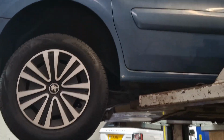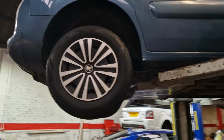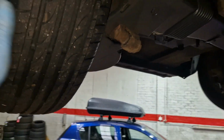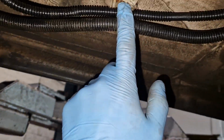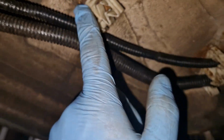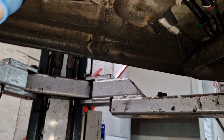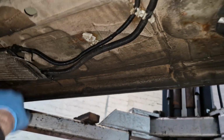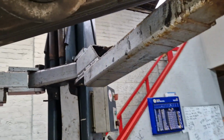Right, the Peugeot Partner again. What happened? I've zoomed. So we know about the bolt, right? We know the bolt's not attached to the shocks, so human error. I don't think this has been human error, because if you actually see it, it's been hit there as well. So it's bent all the stud over that holds the fuel piping. I don't see any other damage, to be honest with you. So we'll just need to bypass this at the minute till we get a new one for it.